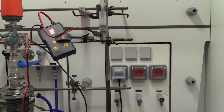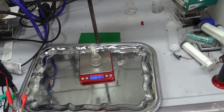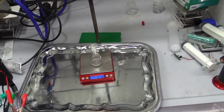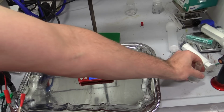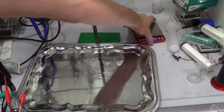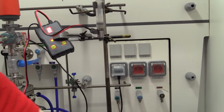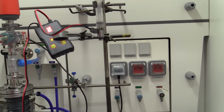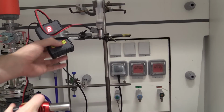and we're going to see what that weighs. And it weighs less than a gram, 0.7 grams, so it's about a milliliter. And just so we're clear at roughly what this is going to look like when we get to the fuel injection stage. So this, bear in mind, is ethanol, which is about half the energy density of gasoline. So, okay, let's give this a go.